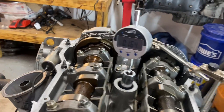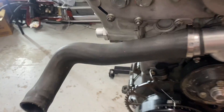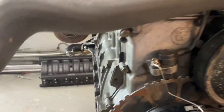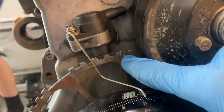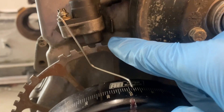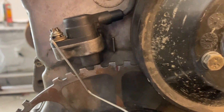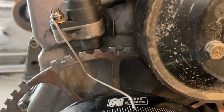Although it's really nice to have this lined up perfectly, it's also good to know that if you don't have a nice pulley and dial indicator - if you have the OEM crank marker, as long as it looks basically perfectly lined up, don't stress. As long as your cams are also at TDC and that's lined up with your OEM crank marker, you should be good enough.